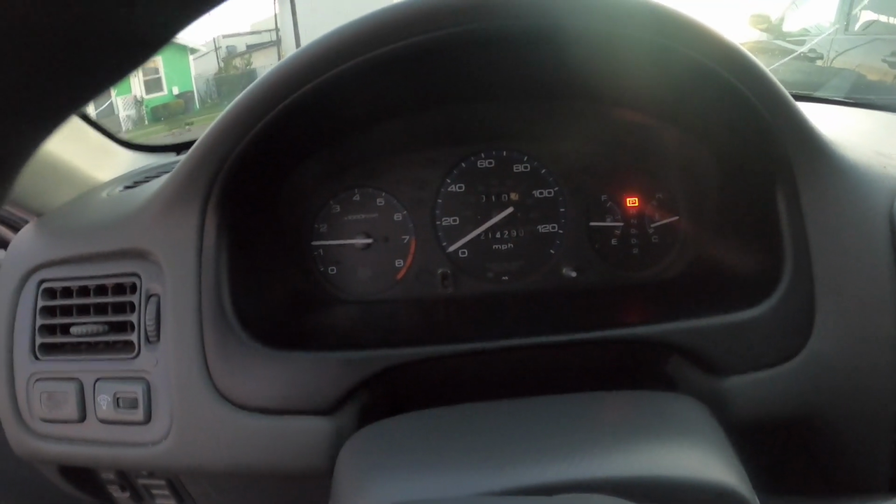Heck yeah, man. So we did just go ahead and do the head gasket on this thing. It was misfiring pretty bad. It had the burnt valves, and I also had to throw a crank position sensor in this thing. So I took apart the distributor, put the crank sensor in it, and also the phase sensor on the crankshaft itself. So we did buy those 2 sensors, but looks like we're gonna make some money on this thing. So she's up for sale. Put her up for $2,699, and hopefully she sells here in the next couple days.